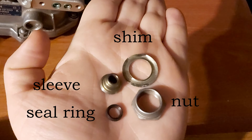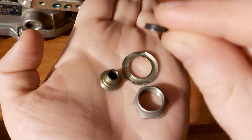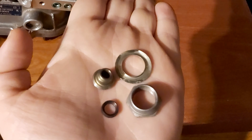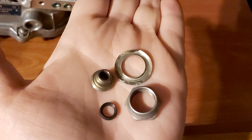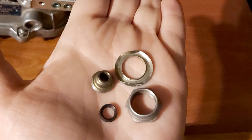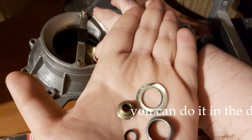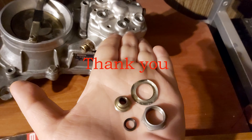So there you have it. If you have any leaks, then either this seal ring — or, if you have replaced the injectors, then the cold start valve. And that's it. If you can smell fumes from your engine as you pop up the hood, then it can be the seal ring.